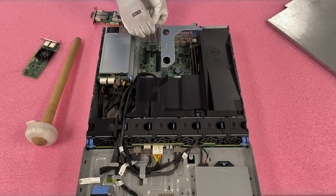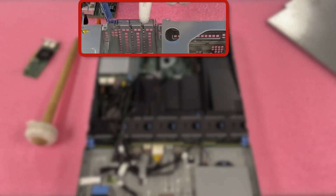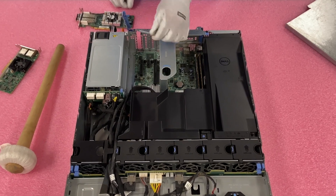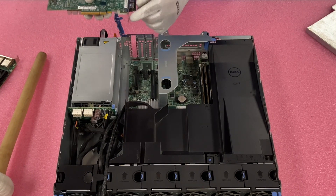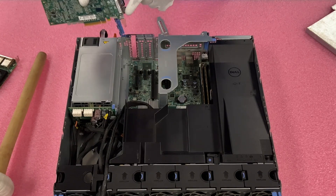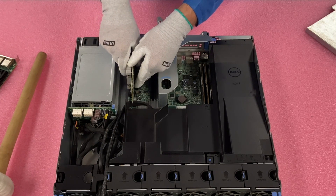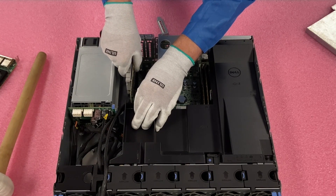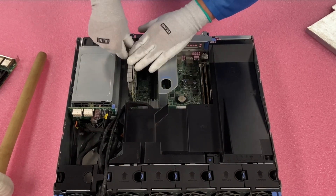You'll notice there are three brackets in here and you'll need to remove one of them. Take the one on the far inside. There's always a little point on the bracket itself and a slot down there — you want to make sure you line that up while also seating the card. It's not difficult, but there's a lot to line up at once, and sometimes cables will get in the way, so just make sure everything is lined up properly.